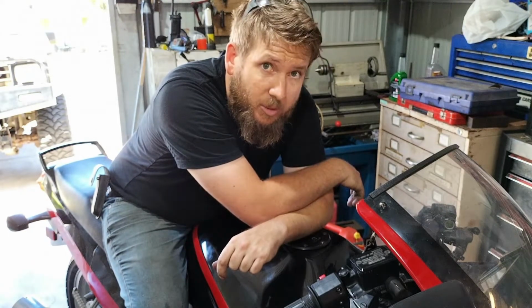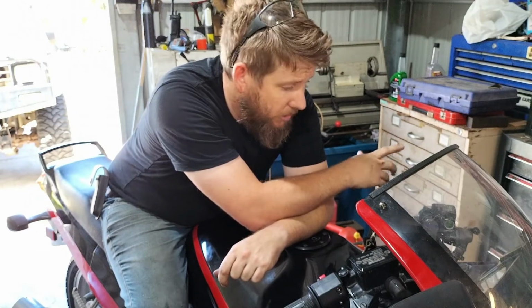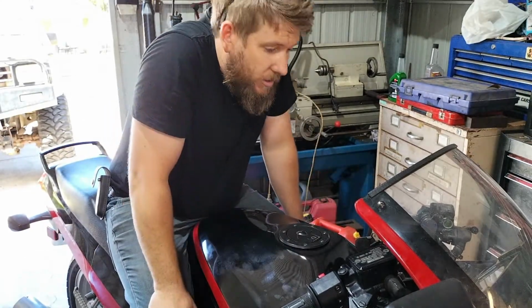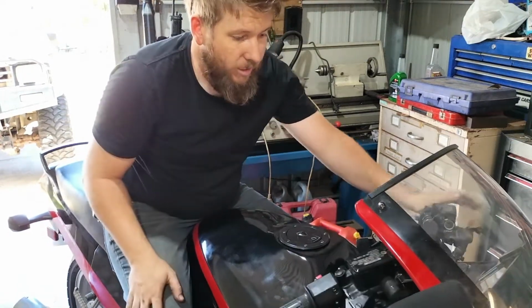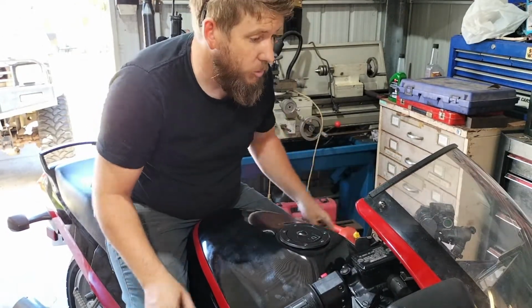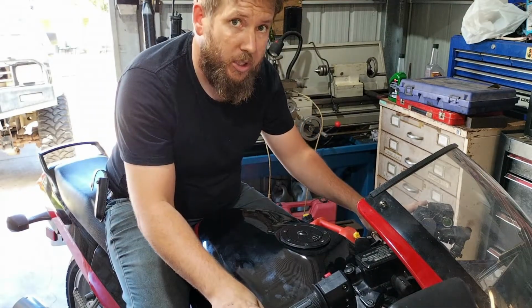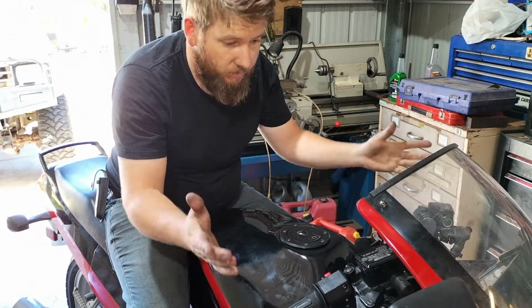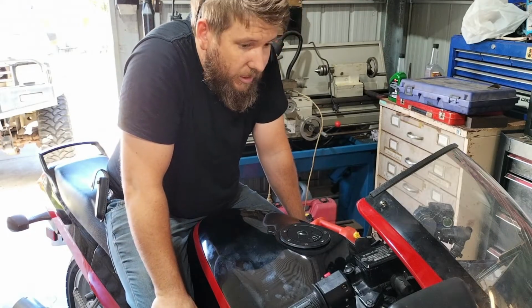And then I can go and get it slipped, like rego, pink slip, blue slip actually, because it's been off the road. A couple other things I've got to look at. I still haven't been through the front end and checked all the bolts. And the other thing that really needs addressing is the headstock bearings are way too loose. You do always want some preload on your headstock bearings, and these have got essentially none. So I'd say the front end's just gone back together and hasn't been set up.